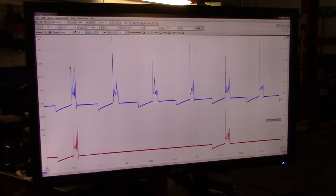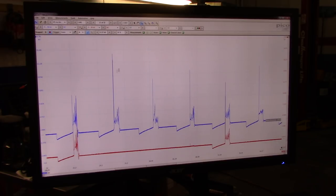So we got a low spike on the coil, which means we have less resistance in order to jump the gap. Let's call that, or it can be just normal. I don't see anything abnormal even by looking at it like this, because we can see the number 3 spike is a little higher compared to the other ones, but the waveform looks pretty even, pretty decent.